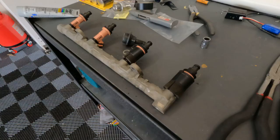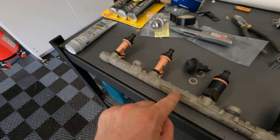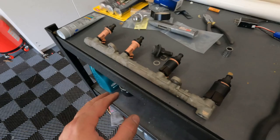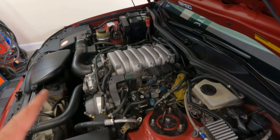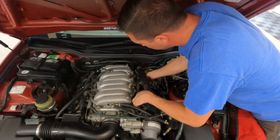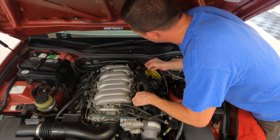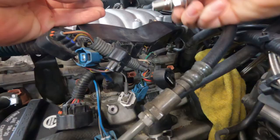Last injector. I used the synthetic grease — the Super Lube stuff — and greased the o-rings that plug into the fuel rail and plugged all the injectors into it. Now I'm going to figure out how to finagle this thing in while hooking up the banjo for the fuel delivery on the damper. It's going to be a little bit of a balancing act, but it should go in okay. Just make sure that you don't drop debris into the ports where the fuel injectors go. Injectors are not plugged all the way down yet but they're all aligned. I want to make sure I can get the damper on properly here first before I tighten that down.